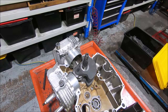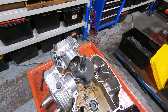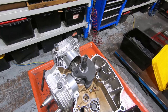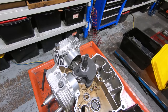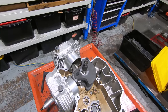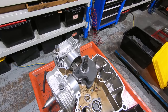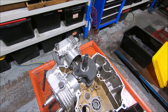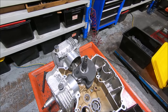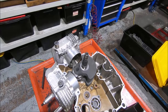When a rod is used and starts getting pulled oval — at top dead center overlap, the piston's flying up with no gas pressure to restrain it, and that's when everything works its hardest — the big end of the rod ovals and the sides get pulled in. If the shell is actually round, it will bind at the part lines as it goes oval. Race series shells have more clearance at the part lines than a normal shell, and that's sort of what makes them race shells.